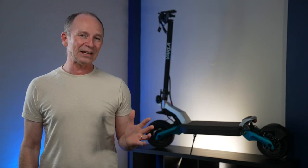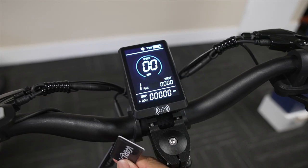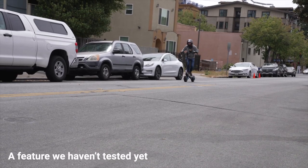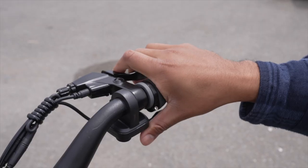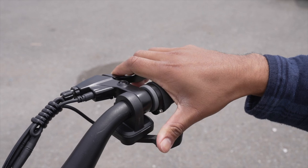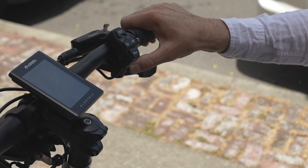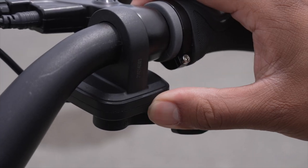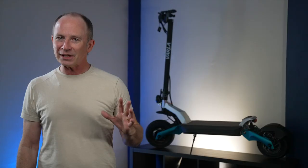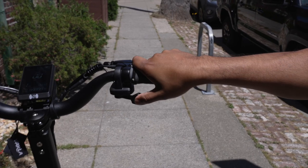The display has a built-in NFC key reader, so the scooter is more secure, but takes a couple extra seconds to turn on. If you don't feel like carrying the key with you, some phones can be programmed to mimic NFC keys. We love the ergonomics of thumb throttles because they let you cover the brake and throttle at the same time, so you can switch from one to the other quickly. The Eagle One Pro uses the same throttle as the NAMI and the Wolf King GT, which means it also has the same dead zone. Anchor your thumb and then rock it into the throttle — this stabilizes your thumb and gives you a reference point since the throttle engages right as your thumb is even with the housing.